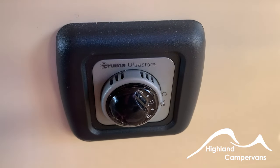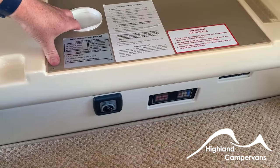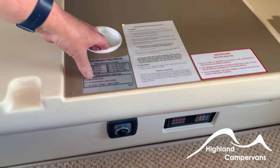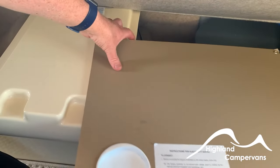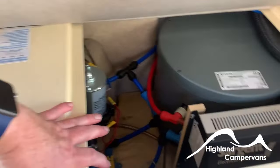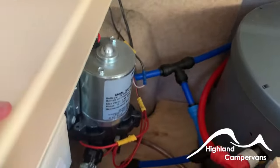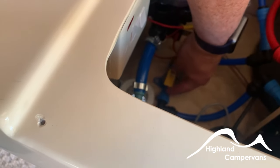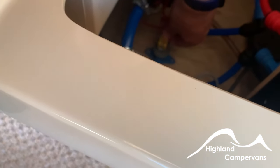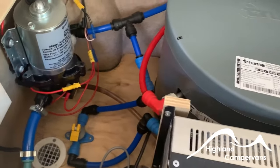Hot water runs on both gas and electric. To select electric, lift the cushion on the couch and move the panel aside — inside is the location of the actual boiler. Down at the bottom there's a little yellow lever that drains the boiler: bring it to the up position for a full winter drain-down and all water will drain out; close it back and water stays within the boiler.